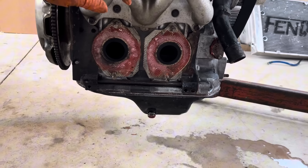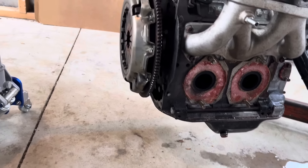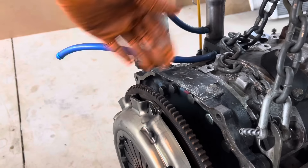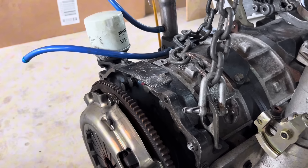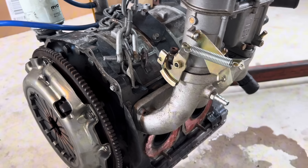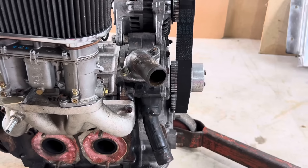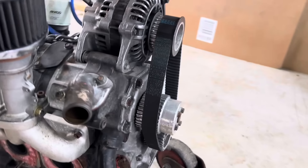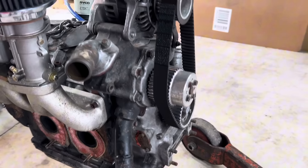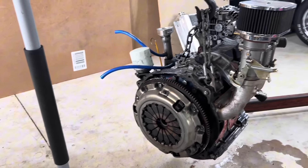Looking through the exhaust ports, the apex seals were all still intact, which is a good sign. But last time we had the oil filter off, there was copper throughout the base — not big shrapnel like I've seen before when running a bearing, but really heavy fine gold dust. I'll cover this when I pull it down with Willie. We'll go through it and give Sam the news on what he wants to do.